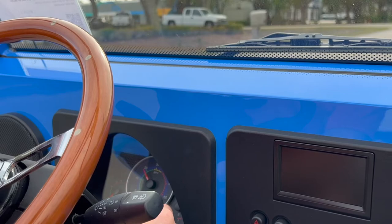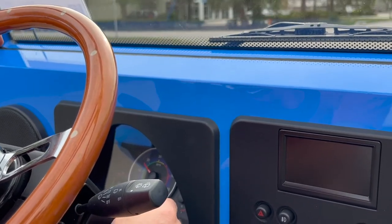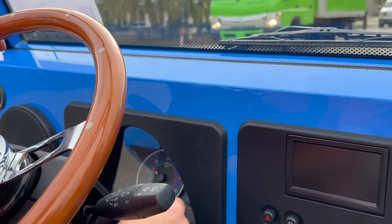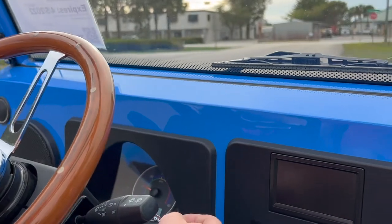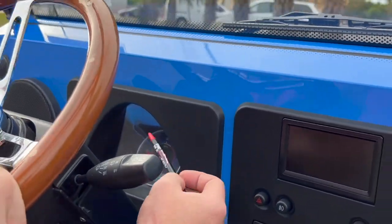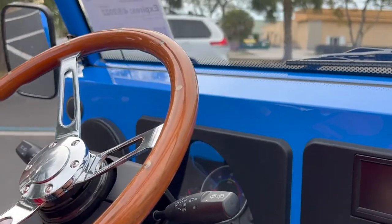You can tell when it's getting ready to happen — the next time you're at a stop and press the pedal in, if that voltage falls below 45, you're going into limp mode. You might see your dash shut off and the Moke do all kinds of funny things until the amperage comes down and the voltage comes up. That tells you you need to charge it.